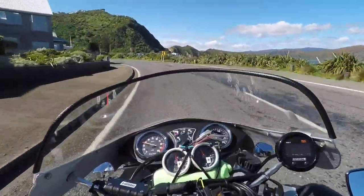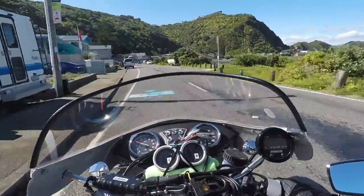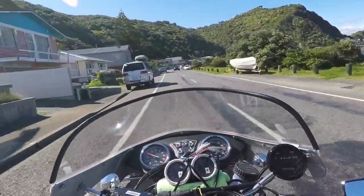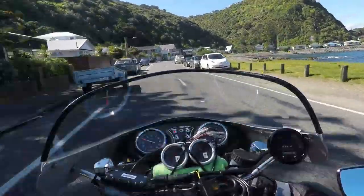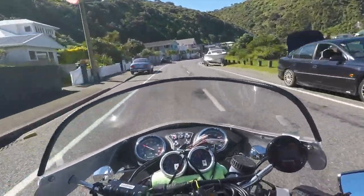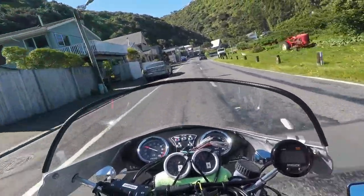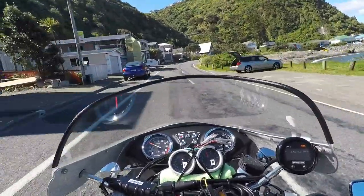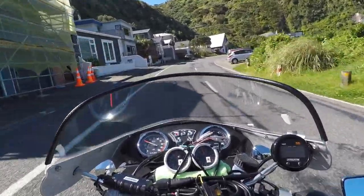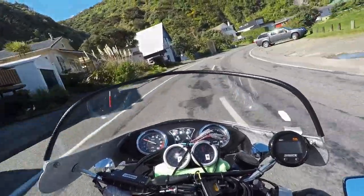I tell you what, that particular spot where I'm looking for where that flat spot is, I'm not seeing that on the meters. I'm seeing is that it goes richer, which you expect when you go on the throttle a little bit. And so yes, that's correct. Going as low as 9-point-something, is that the problem? Maybe it's just too rich overall.